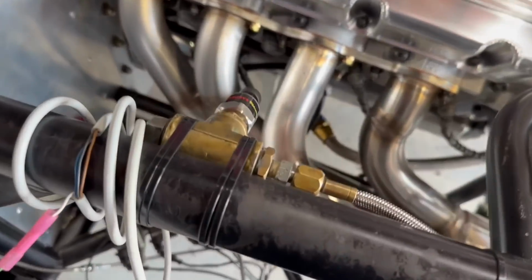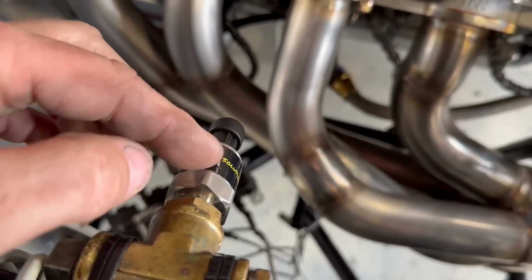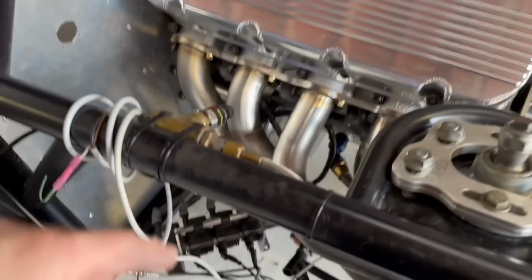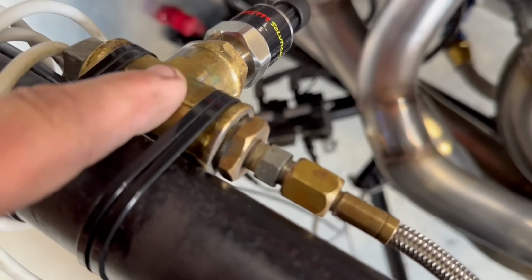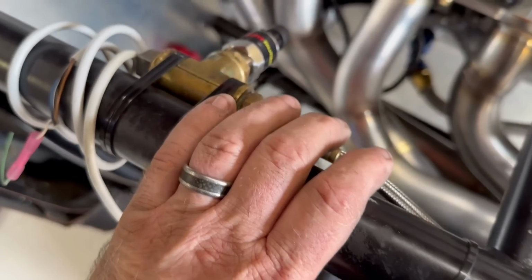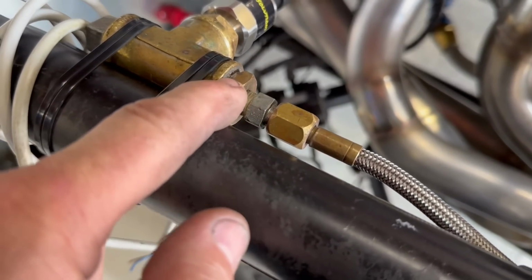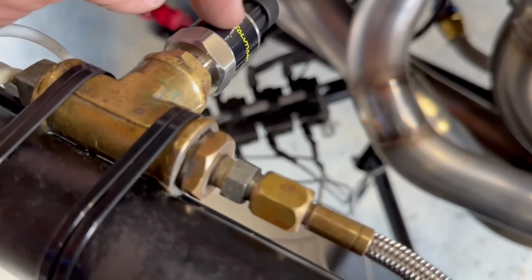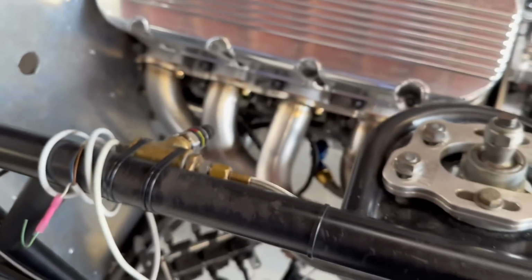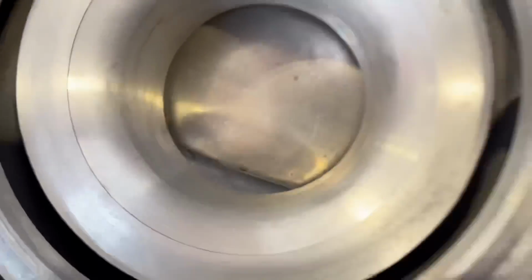And essentially, sometimes this will be erratic. The sensor gets pulses, and so it's real jaggedy when you're trying to data log. I put stainless steel wire mesh in this, like a Brillo pad. It's packed with that, and then you see it comes in this way, and then I've got this off of 90 degrees. So basically by doing this, it really, really cleans up the signal. So we just got this thing cleaned all up.